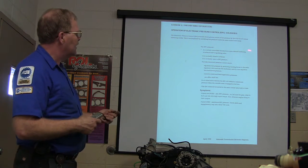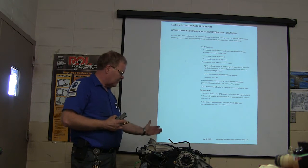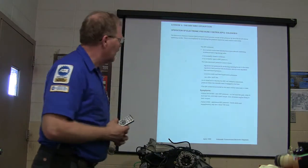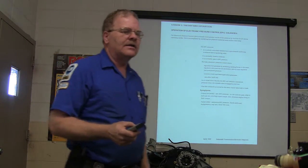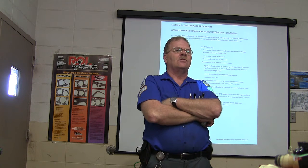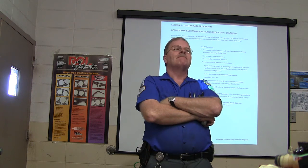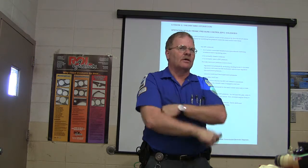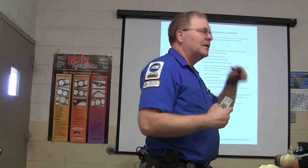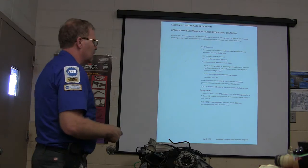You've got an electronic pressure control solenoid — a current-controlled variable force solenoid containing a solenoid and regulator valve. It's similar to idle air control valves on Fords where the more current applied, the more it pulls against its spring. If you lose power going to your solenoids, the transmission puts itself in high gear and raises the pressure all the way up — you don't want soft easy shifts when you lose power. If you've got a shift valve hooked to a cable, never leave that disconnected or the transmission will burn up.